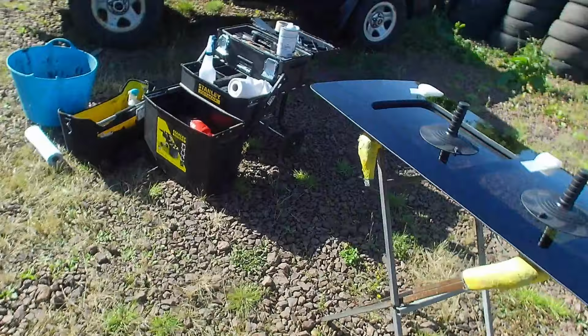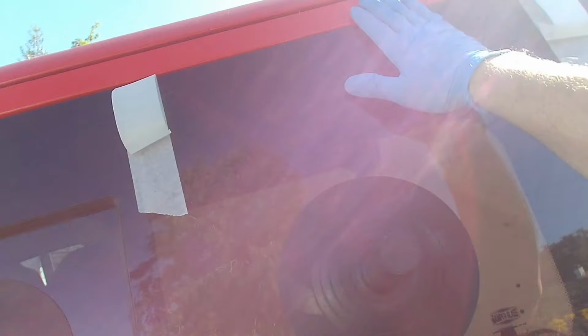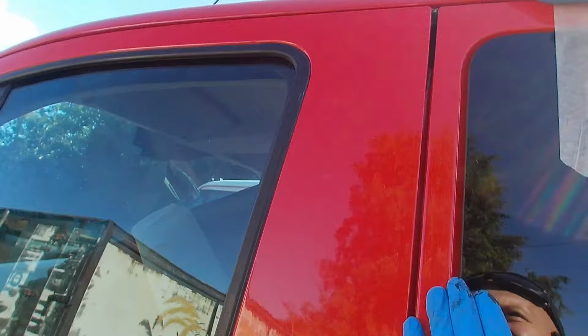And that's it. Basically just line it up into position. I just go up the top corner. And just firmly push it into the glue. Don't slap it, just put pressure on it. And just check the gap all the way around between the glass and the bodywork is the same. Look at it, about 2 or 3 millimetres all the way around.